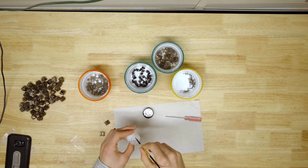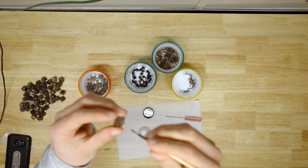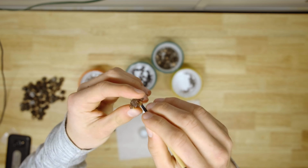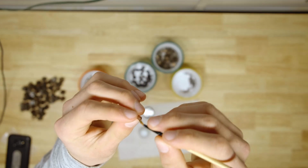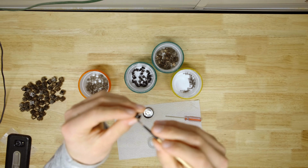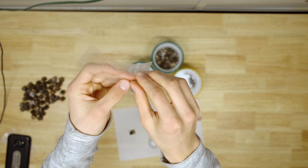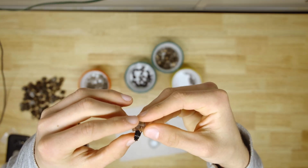Next, I had to lube the switches. The key here is to not overdo it. You can always add more lube, but taking some off is often a little trickier. Pretty much, I lubed the inside of the slider column, then the spring, then the stem, and then for the icing on the cake, I put a film in the middle and closed it back up. This took a couple days, but it's worth it in the end, trust me.